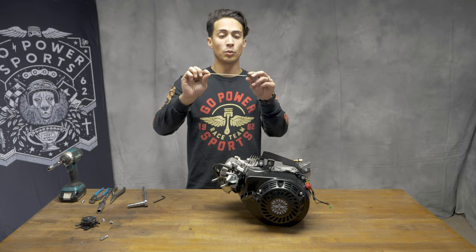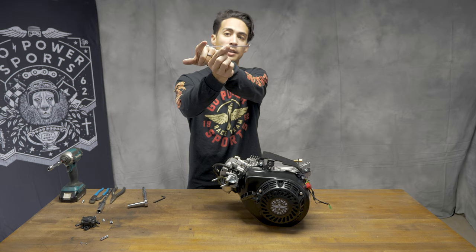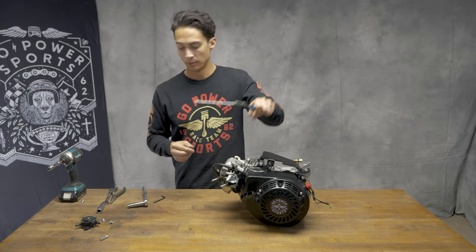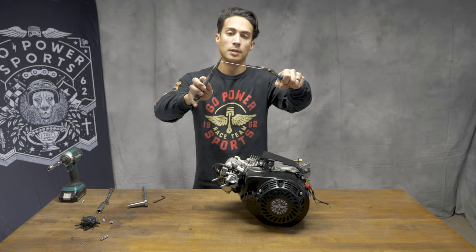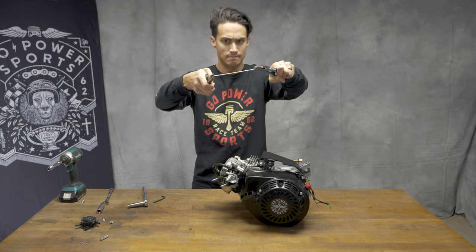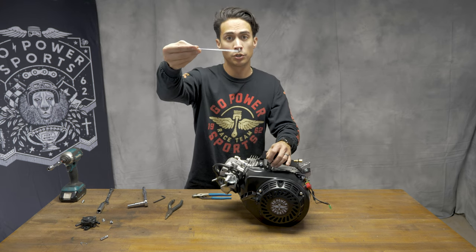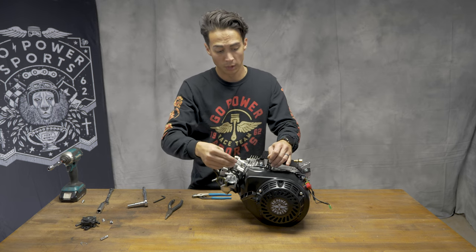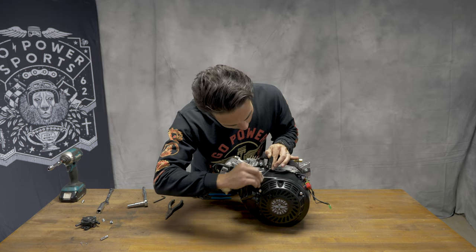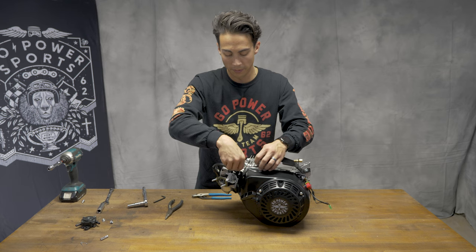Now you do have to do a tiny bit of tweaking. With the governor rod that they supply, you're going to have to turn the end that's bent at a 90 — bend it down 90 degrees. The Z portion of this rod will fit into the short arm that's on your top plate. The L side will fit onto the top of your carburetor, right above the black butterfly.